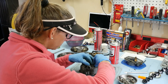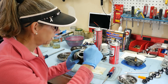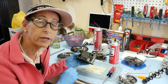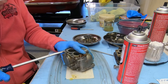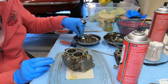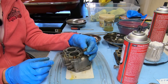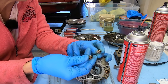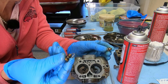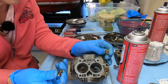Carefully work off this gasket — it's actually in great shape. Now we have a couple of brass pieces that look like big screws. They're actually one-way valves — one is a plug and there are a couple other bits. We'll pull those out to clean behind them. These are pretty buggered up as well. There should be a little aluminum washer on the back of one. There's sludge in this thing. It's important to point out that both plugs have the same threads and will actually fit in each other's hole, but they're very different — one is a simple jet, the other has a little ball check valve specific to the accelerator pump. It's very important you don't get them mixed up.